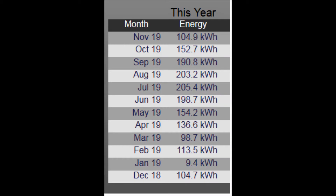This is a screenshot from my energy monitoring system. As you can see over all the months, the refrigerator uses way above the 953 kilowatt hours it's Energy Star rated at. During the summer it really spikes — about 200 kilowatt hours — and in the winter it's about 100. The January 19th date is a hiccup in the energy monitoring system, so that's not accurate. I wish it was 9.4 kilowatt hours, but unfortunately it's not.